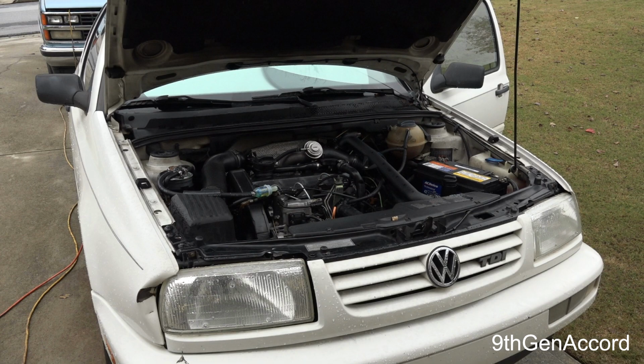So let's just assume I hadn't taken the pump to have been rebuilt, and I knew it was the crank gear. I would probably not have been able to get it started again after I changed the fuel filter, because the pump would not have been able to draw fuel into the filter and ultimately into the pump itself.